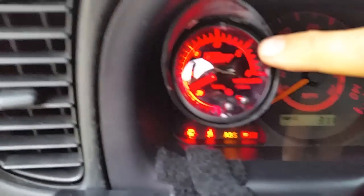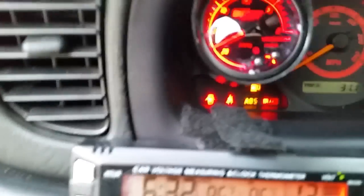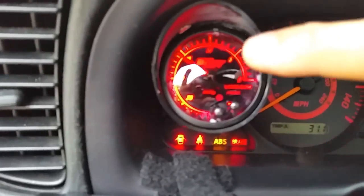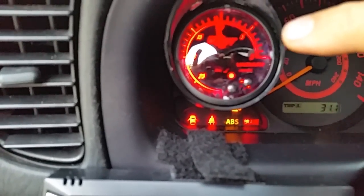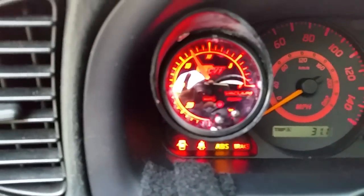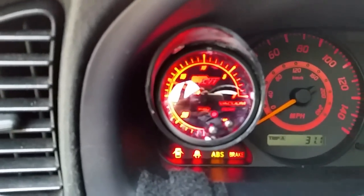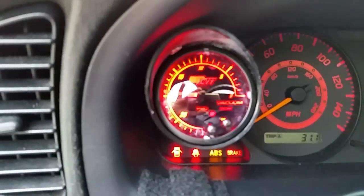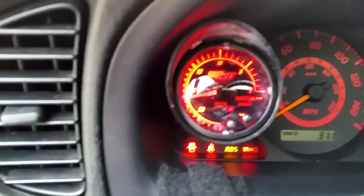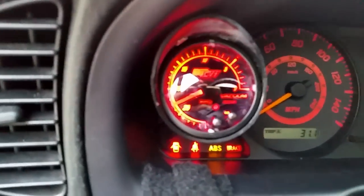This is my vacuum meter gauge that will alert me when I lose vacuum — when the vacuum goes below a programmable value. This alarm is very valuable to me since there's no way to brake with the engine anymore. Direct voltage systems like this one do not have regenerative braking, so if something fails — for example if the fuse for the vacuum pump burns — I want to know right away. Here in Tampa it's pretty much flat, but in a place with a lot of hills I think that alarm is a must.